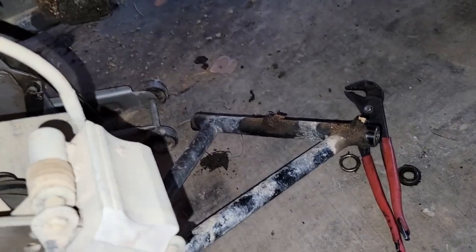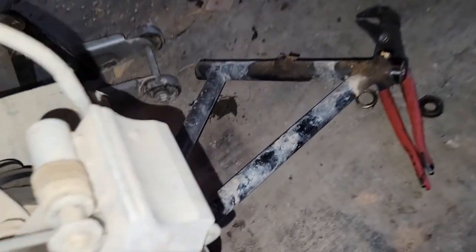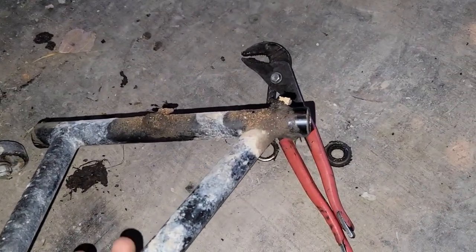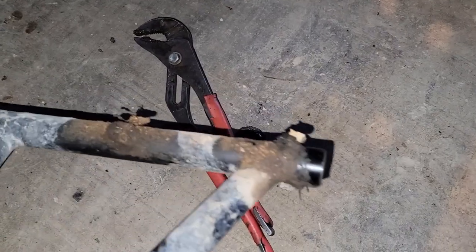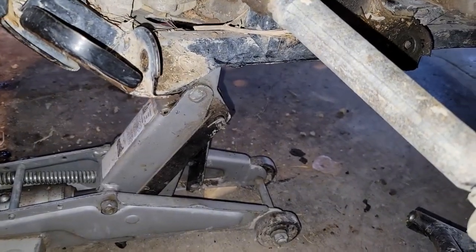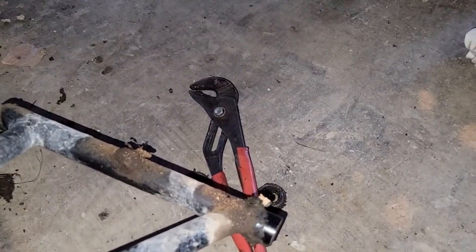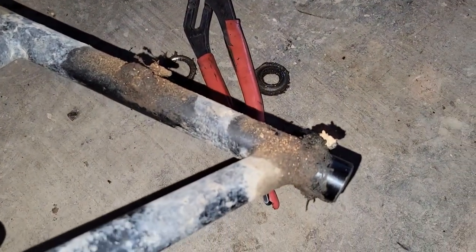Okay, so I just realized my battery died on me during filming of that other side. I just had it on time lapse, so it wasn't like we lost a gob, but basically I went and pulled this side. It's two bolts, one on each, right there, 9/16 heads. And the bar, I think this thing has been in a wreck. In fact, I know it's been in a wreck just because the bends in the tubing don't match up with what should be there.